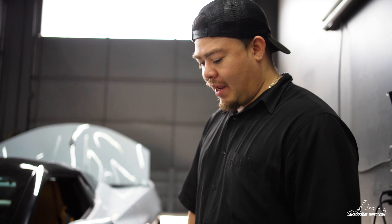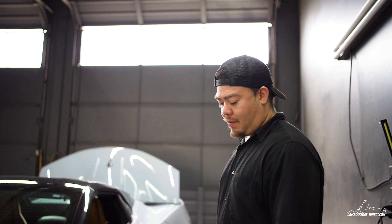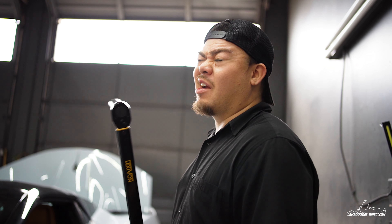Finally got the wheels on, and as we always do with every car, I like to torque the wheels — triple check, double check. It's very important to make sure those are torqued. The torque spec on these from factory is 140 foot-pounds of torque, which is a lot, but that's what it recommends from factory.